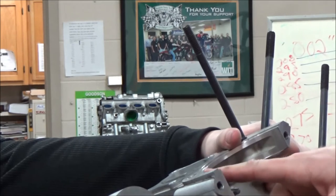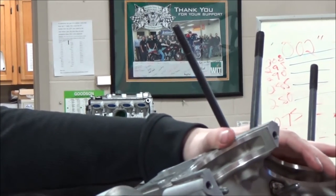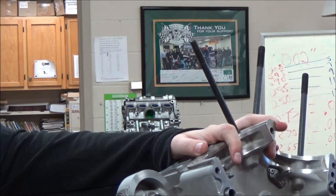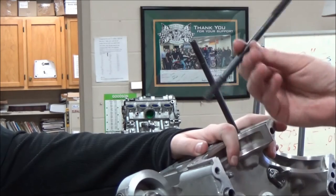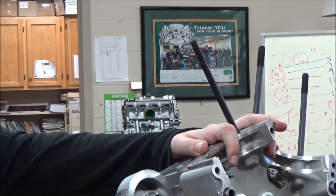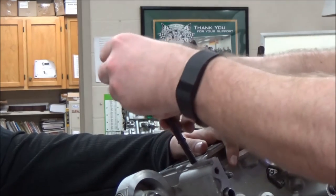Now we get our new stud. We're going to thoroughly clean this hole, thoroughly clean the stud, and then reinstall it. We're going to show you the installation process. You can see we have the flange side that goes down — we'll find some Harley motors where that's up — but for this application I'm putting some Loctite on. I do not want this coming out.